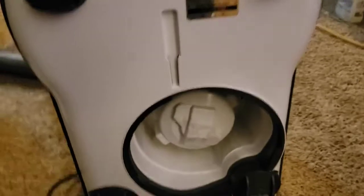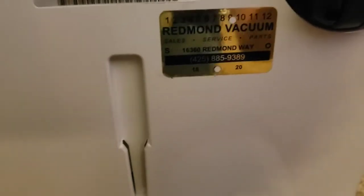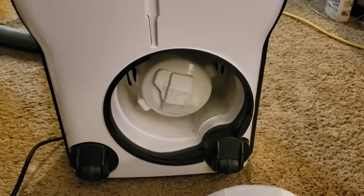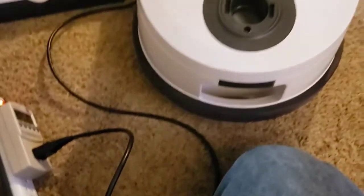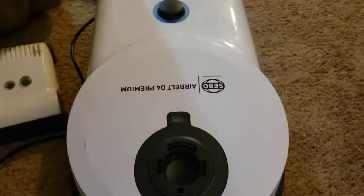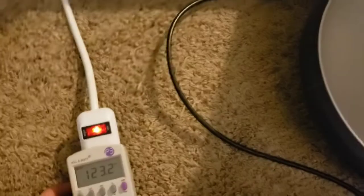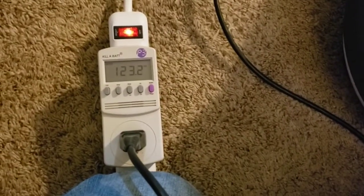This is only around two years old, so I don't know why they donated it, but whatever — means I got another one. Unlike the E3, this has a power button on it so we can actually run this without a hose. We'll first take the voltage and wattage with the canister alone, and then we'll attach the hose and the power nozzle and take readings there too.